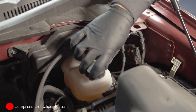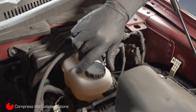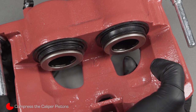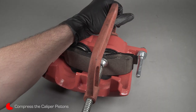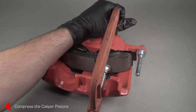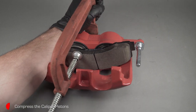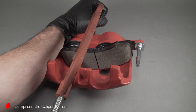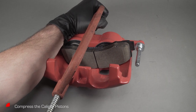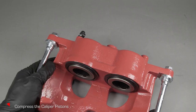Before the next step, compress the caliper piston back in. Make certain the brake fluid is about half full and monitor the fluid level while compressing, as it may overflow. The piston has extended as the pad material wears. With new, thicker pads, you must return the piston back inside the caliper body to give the thicker pads room for installation. Using a piston compressor or large C-clamp, place a used brake pad over the face of the piston to protect its surface from marring and begin compressing. Push the piston in slowly to prevent unsafe back pressure and damage to the ABS modulator, brake valving, or master cylinder. Monitor the brake fluid reservoir level while compressing. Then loosen and remove the piston compressor or C-clamp. It may be necessary to drain some fluid from the master cylinder reservoir.